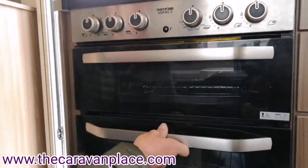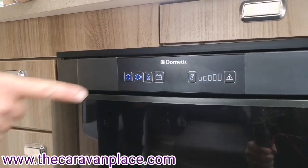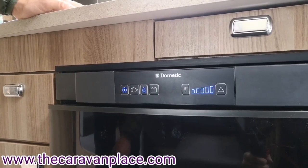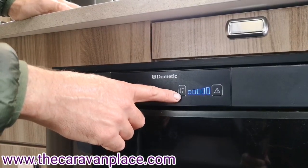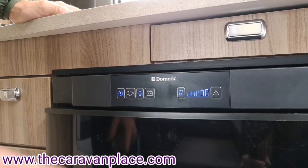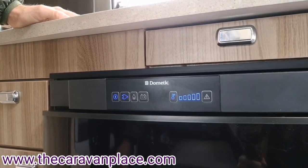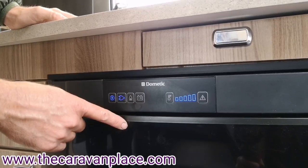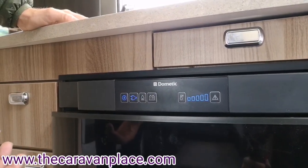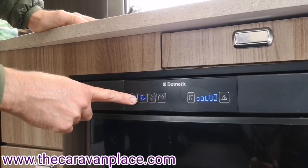Everything like our fridge — if we use it on gas it will all light up much easier. To put the fridge on we literally just hit our main on button, it'll go over to gas and you'll hear a little ticking noise, then it should light up on the gas and stay lit. We can control how cold the fridge gets with the little control dial. If we're on 230V and didn't want to use gas, we can press our plug symbol and that will run the fridge on 230 volt. If we're towing with the 13-pin connected, we press the battery button — once we start the engine it will run from the vehicle battery. It won't freeze down like on gas or electric, but it will keep things nicely cool.